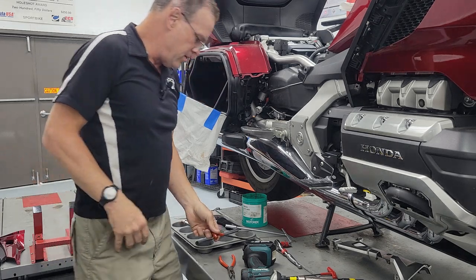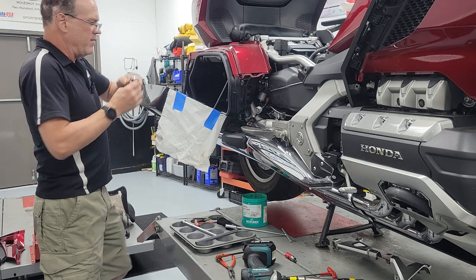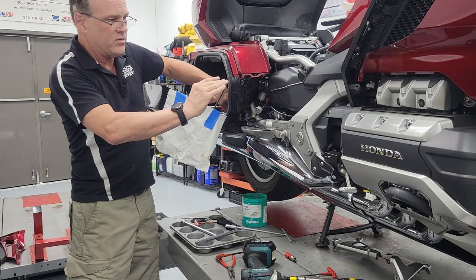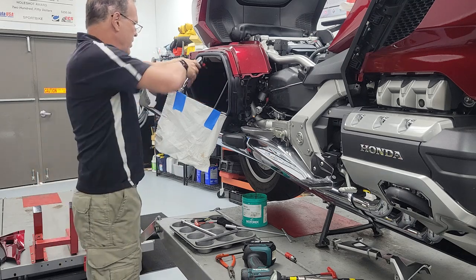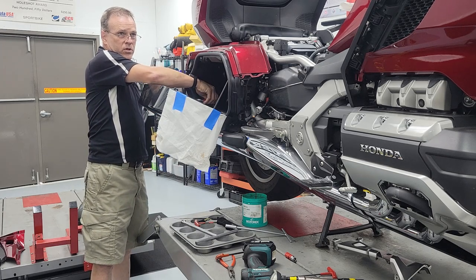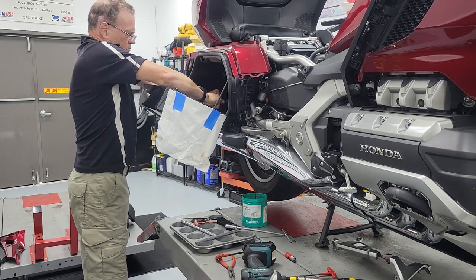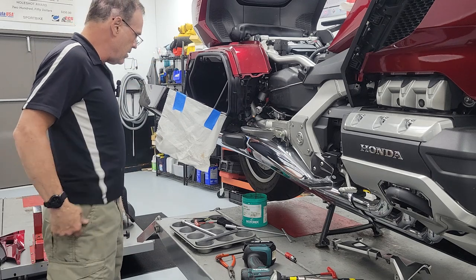While doing this I'll talk about setting the adjuster. It has eight full turns of adjustment — you might find a little more, but the intention is eight full turns. Once you feel it touch and it starts to put pressure, one full turn of the adjuster is equivalent to three digits on a 2001-to-2017 bike. So you can think of each third of a turn as one increment. Our goal was to give you the 1-to-25 range just like on a 2001-to-2017 bike. Working in one-turn rotations is a good approach — three, six, nine, twelve — you can get in where you want to be.